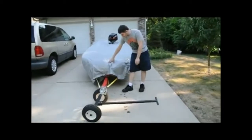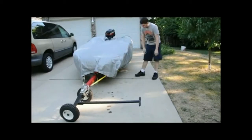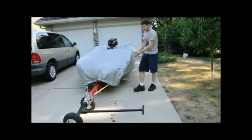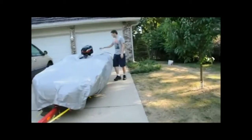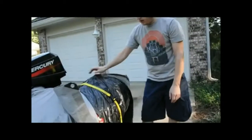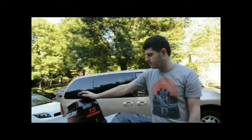The tarp needs to be really tight so the wind doesn't blow it off. I have latches all over the place — one going underneath that kind of wraps it around. You want something that doesn't allow it to dangle below, because you want airflow to get underneath so that when it rains you don't have moist ground causing mold on the bottom of your boat. I have all this tight. The easy way is I use garbage bags — these are waterproof — and then I have straps covering it. That's pretty much how it sits for storage.